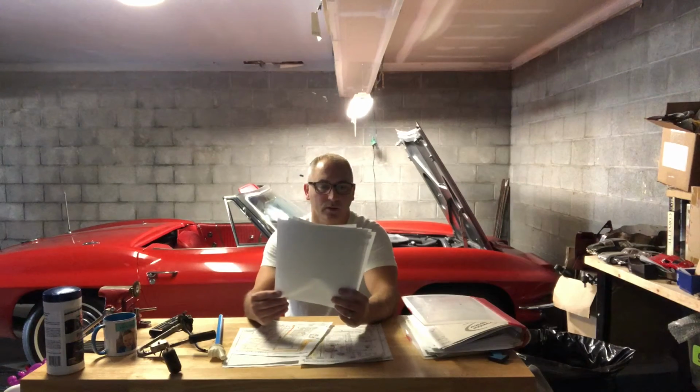Then we got somebody that says, don't have a diagram handy, but the circuit also powers the fuel tank sending unit. Pull the rear harness connection apart underneath the dash, or pull the pink off of the sending unit from the fuel tank. Because it's an odd bod powered C2, the sending unit receives 12 volts, a full 12 volts from the rear harness connector.